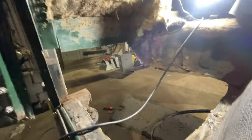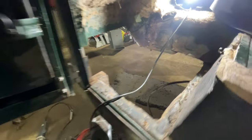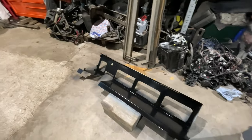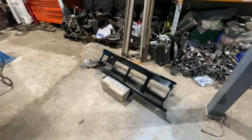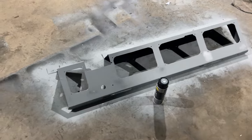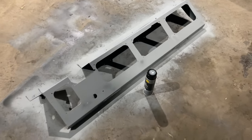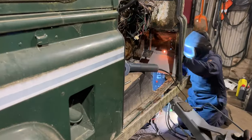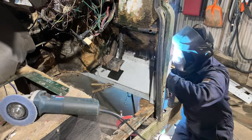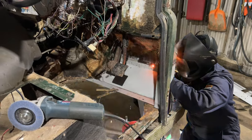I think the steering column is pretty much good to go. As far as the green Defender is coming along, Mikey has one footwell out — he isn't going to do the whole thing because it's quite solid up there, so he's cleaned up and ready to put the other one in. I've also been painting the inside of the dashboard — a couple more coats of primer and three coats of satin black, because that doesn't need to be body coloured, just the outside does. Once that's dried I'll prime the front and it can go off for paint. The dashboard front is now primered, ready to go off for paint. The driver's footwell is in, almost just being finished off — the wing mounting bracket is just being welded back on.